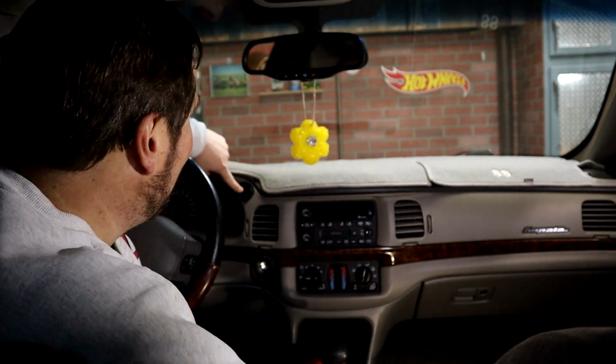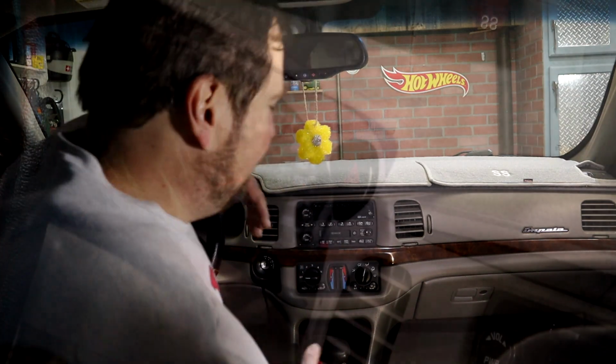I have a problem. Yeah, you haven't made any restoration videos in a while. Yeah, I know, but my brake lights don't work. And I know what the problem is, because I've done it twice before. It's this hazard switch. It controls the hazard lights, obviously, the turn signals, and the main brake lights are run through this. So when your brake lights don't work, or your turn signals for that matter, it is in this switch, and I'm going to show you how to replace it.